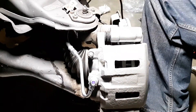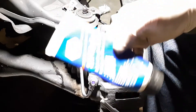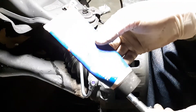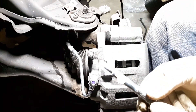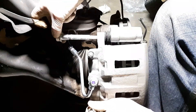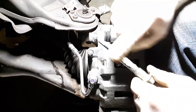There we go. On this particular model the slide pin bolts are already coated as you can see — the clear filmy stuff. But here is the lubrication to use: silicone paste — only use this, not grease or anything else. You can get it at NAPA for about five bucks a tube. Put just a dab — you don't need much — then pop the pins in and thread them in.